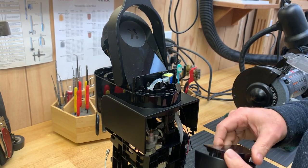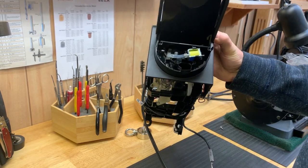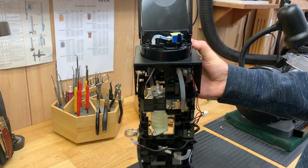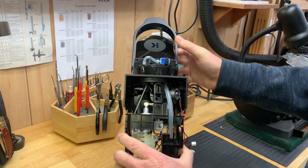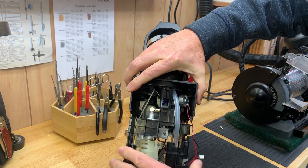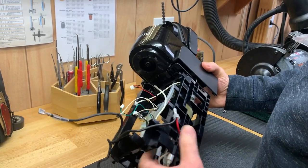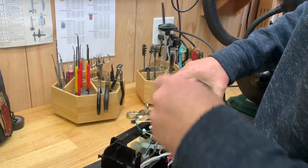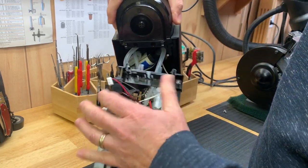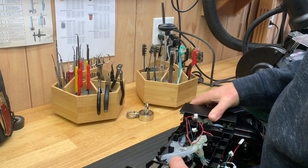That was important because if you look down here, you won't be able to see too well, but there was a screw down here that I then removed. And once I removed the screw, I had disconnected the strut from the main body to the top. Now, with that rear strut disengaged, it seems like this will just snap out from the top like that, with these two plastic pins fitting into here. So now the top has been removed.